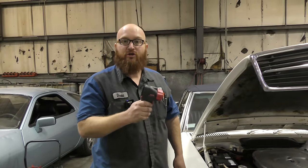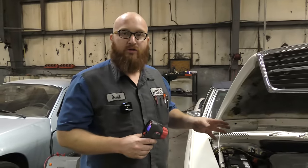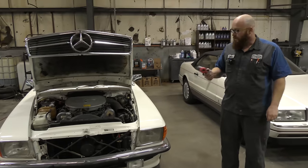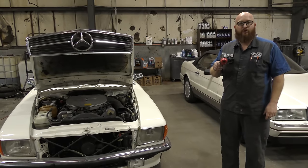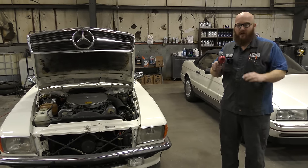That's the kind of tools that I like to use. It takes 20 questions and turns it into one question, one answer. Now I'm going to turn it off, plug the spark plug back in, and we can turn on the AC — we're going to show you guys how that works. Now we can hear it's running a lot better with the spark plug wire plugged back in. We're going to use this camera now to look at the condenser up front. Maybe we're thinking it might be partially plugged — we can take a look at that with this camera.